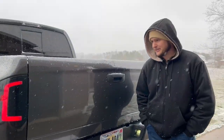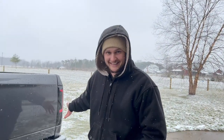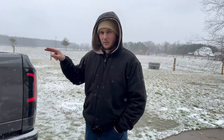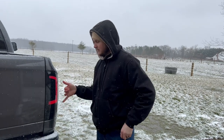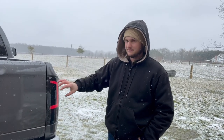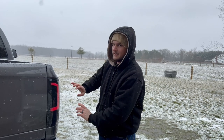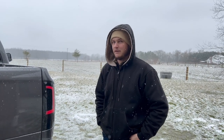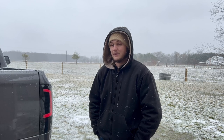Here we are, new set of tail lights installed — looking good. We actually have a blinker on both sides now, not just one. That tail light wasn't even fastened in — I don't know how that thing stayed in there. The screws were in the tail light but the tail light was just popped into the little grommets on the sides, and the screw heads were not fastened through the bedside into the housing. It was just popped in — wild that it wasn't just laying on the road.